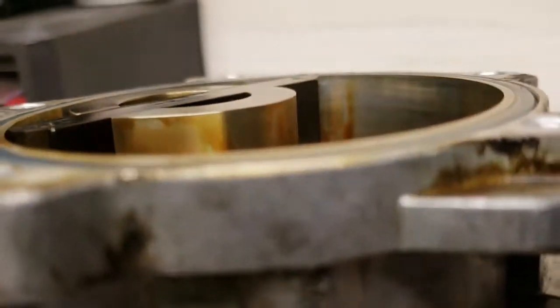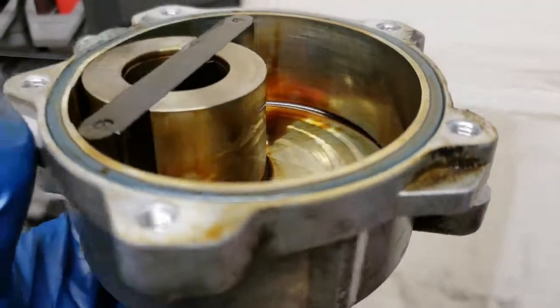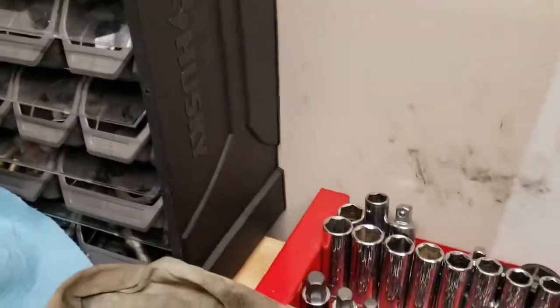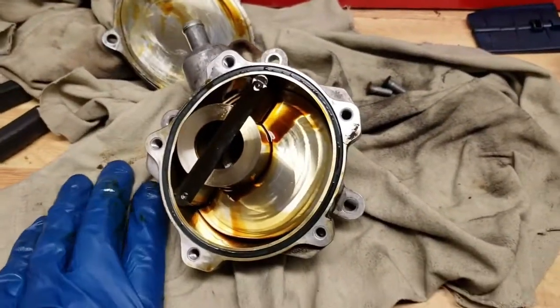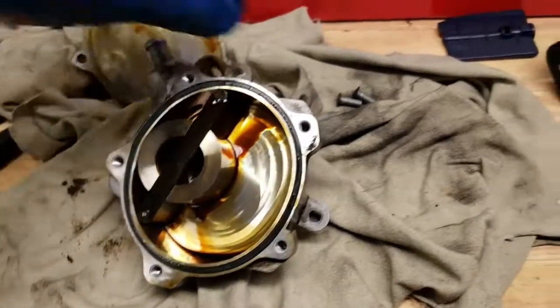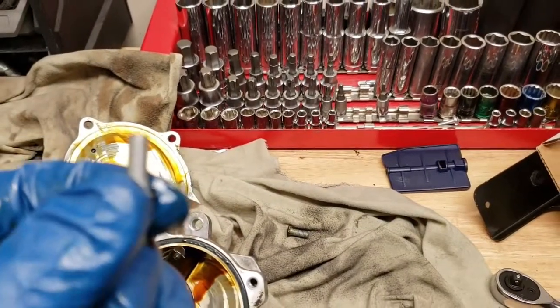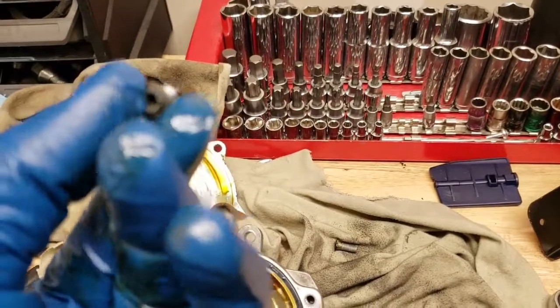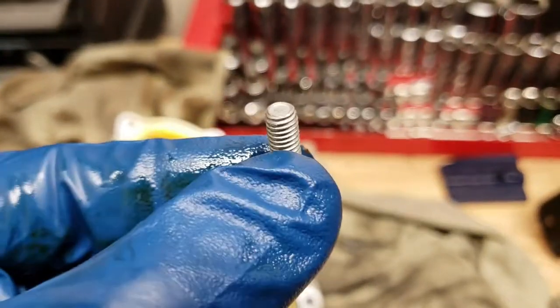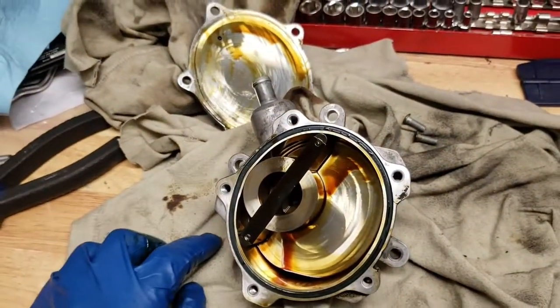Let's go ahead and remove that. Clean the surface, mating surfaces, and put the other 6 bolts back. The tool you need for that is a T25 or Torx Bits 25. And I believe, I'm not even sure, I will have to go check, but just by the size of this, guys, looks like 8 Newton meter will be sufficient for it to hold the top to the vacuum pump itself.